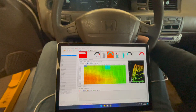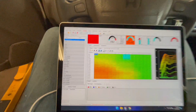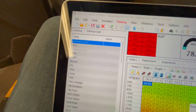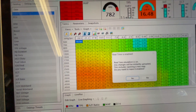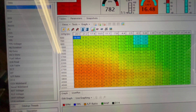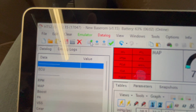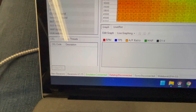So let's go ahead and turn the key on. Let's go down here and connect to the ECU. Let's turn the fan off. What this is saying is real-time tuning is enabled. So if you click yes, then it real-time changes what you do to the ECU via like an auto update. As you can see now, it turned green — we're connected.